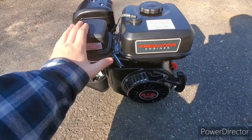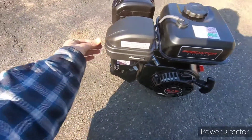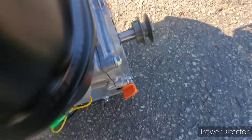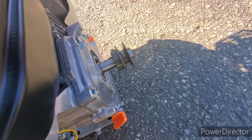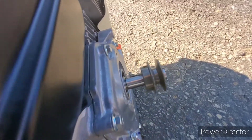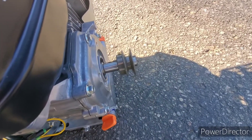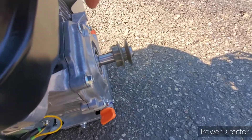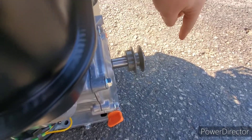This little six and a half horse — I already have the two-inch pulley on it, because it's going to be running a two-to-eight pulley setup, which will give me a four-to-one ratio. Every four turns of this is one turn on the transmission.